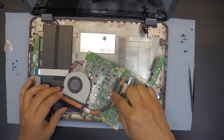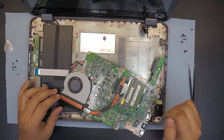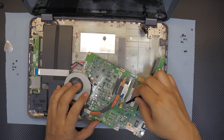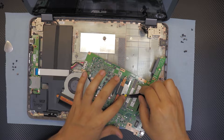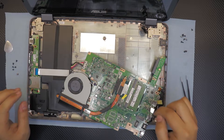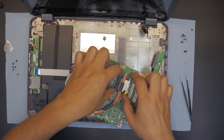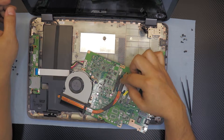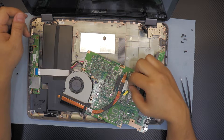I don't like these clamps they use for holding the CPU - these are flimsy clamps right there. This is the warranty sticker, I'm just gonna put it to one side. If you wanna replace the thermal paste you have to unscrew the four screws right there and clean it up and put the new thermal paste. This laptop is brand new so I'm not gonna void the warranty to do it.